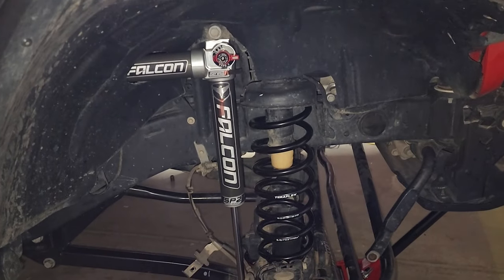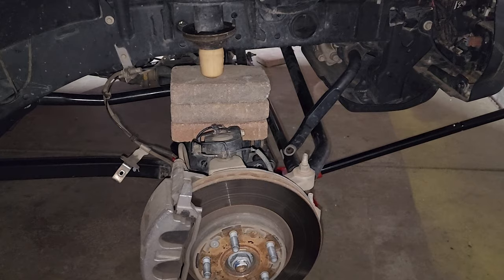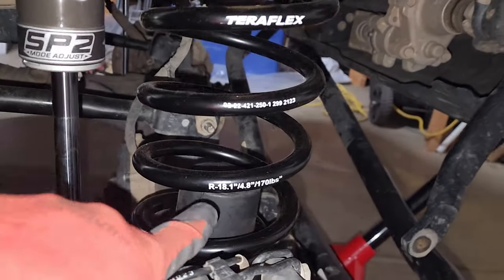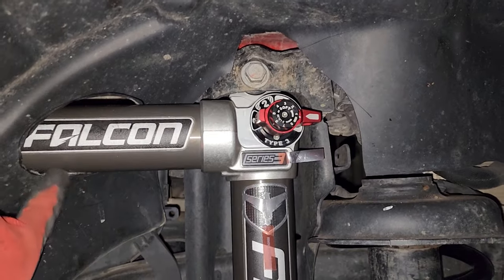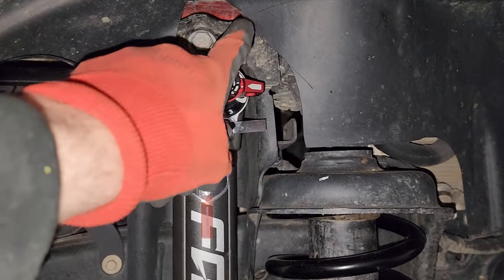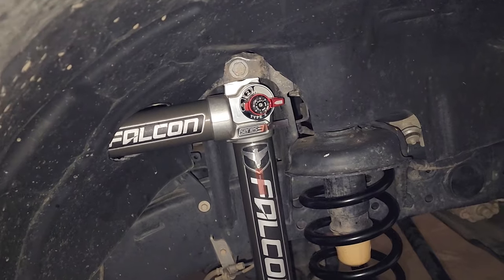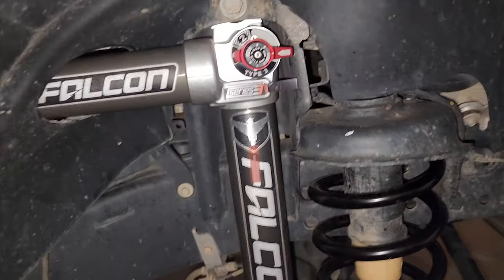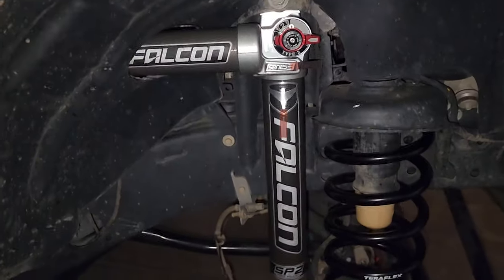We've got the shocks on there, and we've got the new springs and the bump stops. Now the bump stops took a little ingenuity to get them to press up in there, because it was a little difficult. And if you look right here, this is a 2-inch bumper for the bump stop, so that's what will hit that on the spring here, and they're labeled right and left. And there is the shock. Right now it's on its softest setting, but you do have to cut a hole here for this to go through. I did have to cut this out so I could access this and the bolt, because with the shock in there, the bolt did not want to sit nicely. It takes a lot of fidgeting to get it in there, but once it's in there it's great. The plastic gets caught up around the bolt and you can't pull it loose unless you wanted to rip it all out, but it does give me more access to everything.